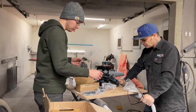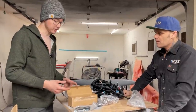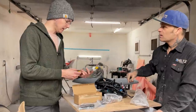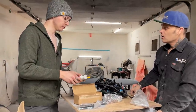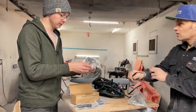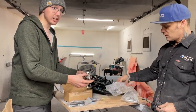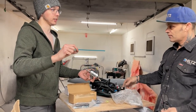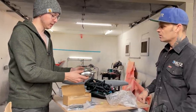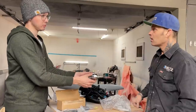The main thing this would need where an old small block wouldn't is a high-pressure fuel system. That's why I had to get a really good high-performance fuel pump — it was a little bit pricey. It should be around 50 to 60 PSI. This here is your fuel filter and regulator all-in-one — it filters and also regulates the pressure.